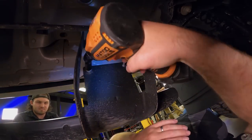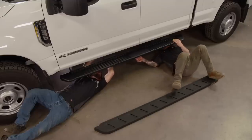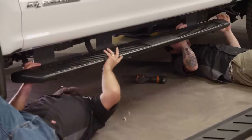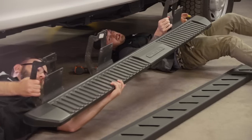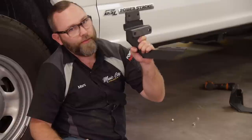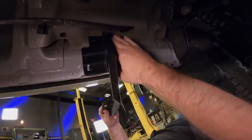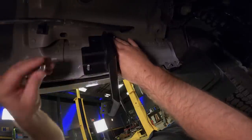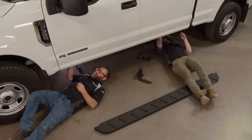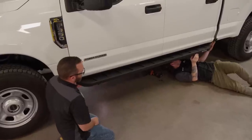Side steps are probably one of the easiest upgrades. It all starts by just loosening the nuts that hold the step brackets to the body. Now we've got to take these new brackets — they're going to bolt exactly where the factory brackets were bolted, which is pretty convenient. You've even got a little padding on there so you don't rub the paint off the body. The factory steps worked okay, they're just cumbersome off-road. And they didn't look great. Yeah, that looks cool.